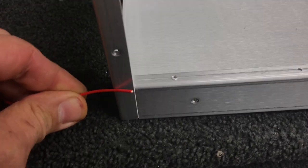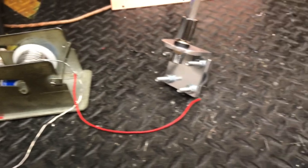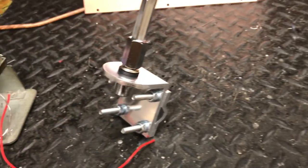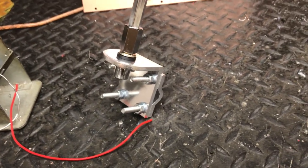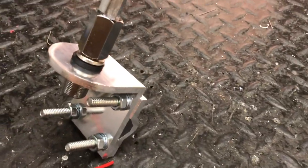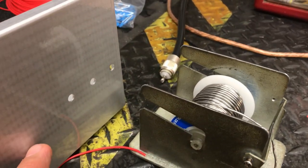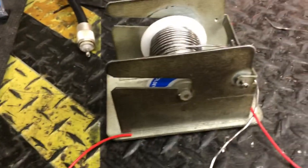You continue that chain — bracket, wire to first metal, short wire to next metal, next piece of metal to the frame. That's how you create an indirect ground that does not become part of the antenna. Then you set your SWR and you're good to go. Do not run a single long straight wire to the frame — that will tear up your equipment. Keep every wire segment as short as possible.